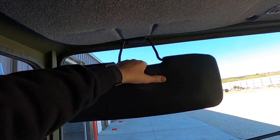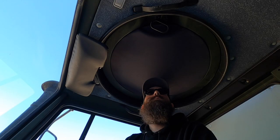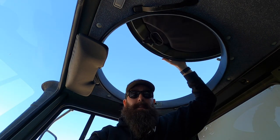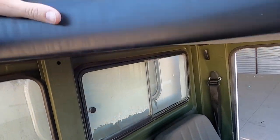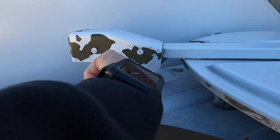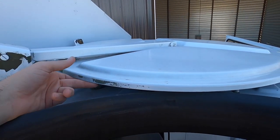It's kind of a cool feature — you have your sun visor but it also folds down about half the length of the window. Let's talk about the hatch, which is actually our sunroof now. Two latches, one here and one here — pull down and turn and the whole thing lifts up. It slides over in a lifted state. Using the handle you can lower it down and now it's in a locked position, so you can drive with this hatch open.